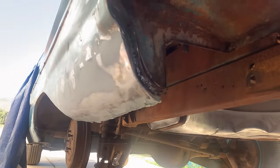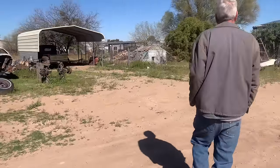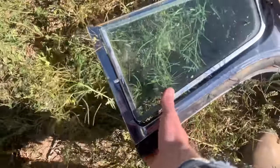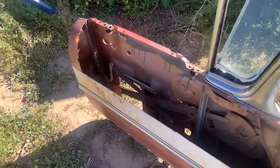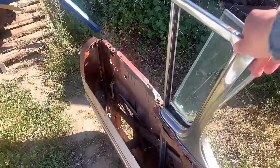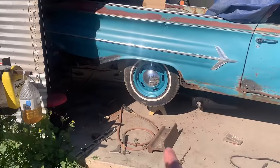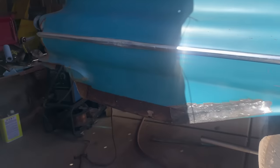This door right here is for a '55 Oldsmobile. The curvature of this door is what dad cut out to use as that rear quarter. We don't make a practice of cutting up nice parts from old 50s cars. Those doors are off a four-door car — my dad tried for months to sell them, nobody wanted them. We're never going to restore a 55 Oldsmobile, so it's either scrap them or repurpose them, and we chose to repurpose them. Dad's got this door on the block and it's going to go on the other side where this rear quarter was rusted out.